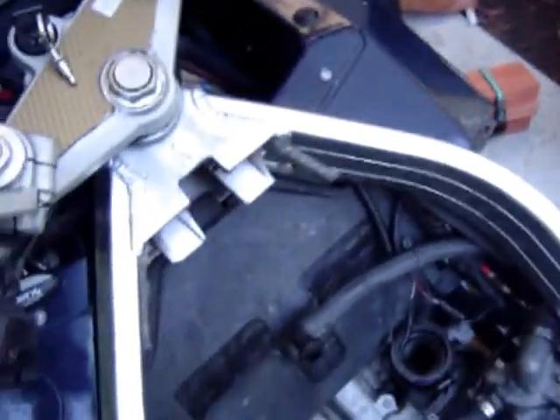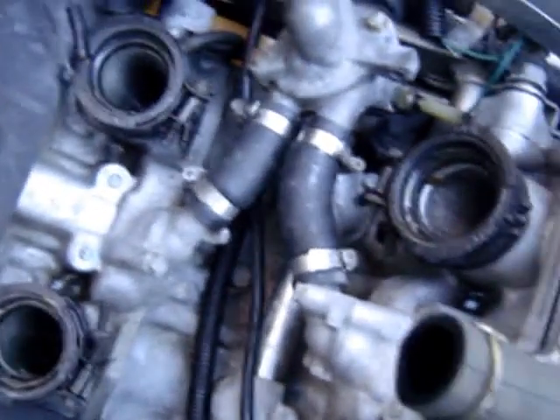I tried to scrape it already and it didn't come off, and what did come off went into the combustion chamber. I tried running it through my gas tank — a full can over a month — and it didn't seem to do anything. I'm also trying to fix a few things that annoy me, such as these coil packs. I wasn't sure if it was my spark or my coil packs, but the connectors are all rusted up.